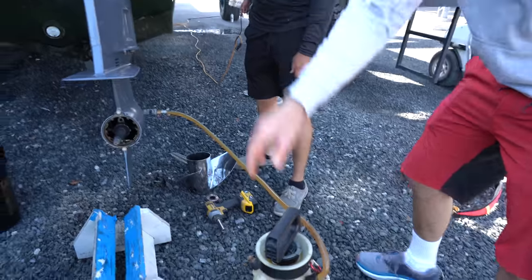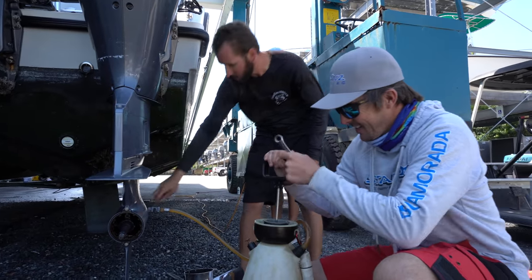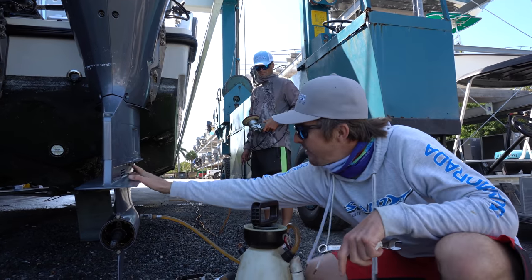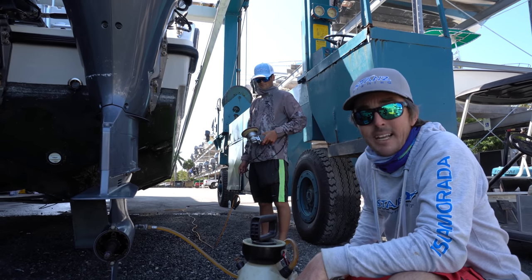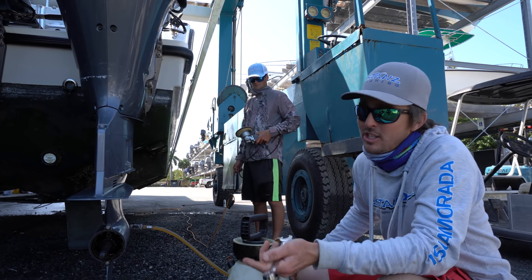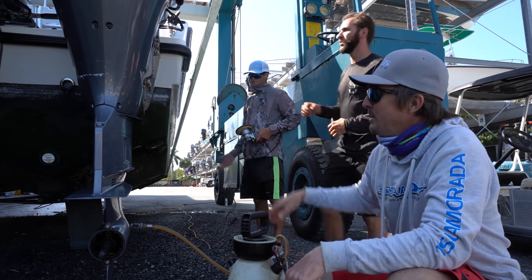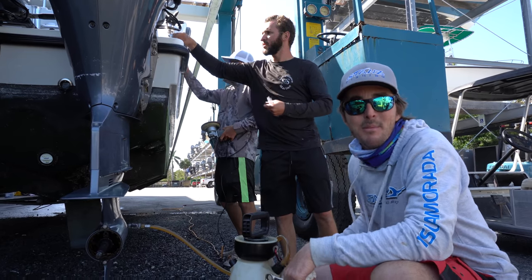We'll notice he's getting the motor vertical. We're gonna pressurize it — it's pressurized. We got five of the six nuts already off the lower unit. We're gonna drop that down, change out that impeller, and show what the old one looks like — it should be in really good shape. Dawson's waxing the boat and it'll be a fun day today. Good day for maintenance. It's windy.